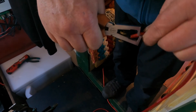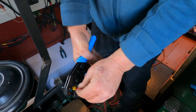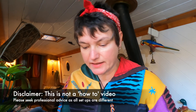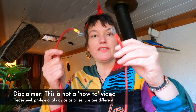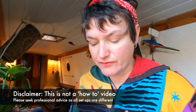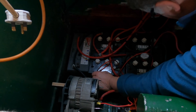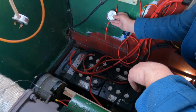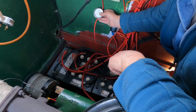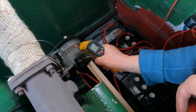My lovely dad came back again. By having a longer length of cable you're actually reducing the amount the lithium can draw, because it gobbles current up really, really fast — that's why I'm going to try this idea. So this is the length of the old cable we just took off, and my dad put some new ends on it. This is the length of the new cable — it's quite a lot longer. We're going to try that and might cut it down if it's too low. Once the cable was changed to six mil and lengthened, it made a massive difference to the temperature the alternator got to, and also to the amount of amps it was putting out. It looked to be working perfectly.